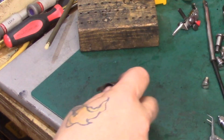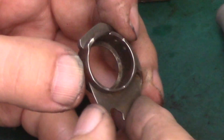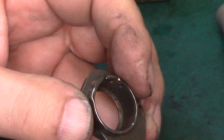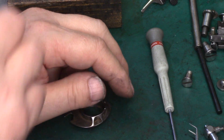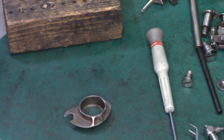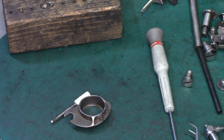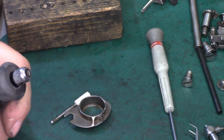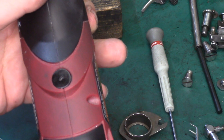We're going to work on the body of the bobbin case first. There's still quite a bit of grungy stuff on there, and I could put it in the ultrasonic, but I'm choosing to do this with just rotary tools, cotton swabs, and a little bit of elbow grease. This is an industrial cotton swab — it has a harder pack of cotton than a household Q-tip, and they do a great job loosening grunge off the surface. I'm going into my selection of rotary tool bits, grabbing a hard felt cylinder, and I'm going to charge it up with some white compound and go to town.